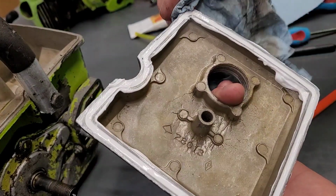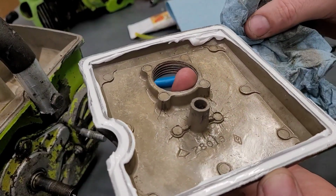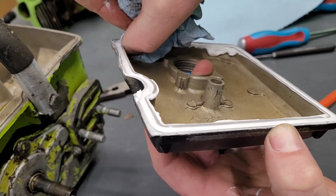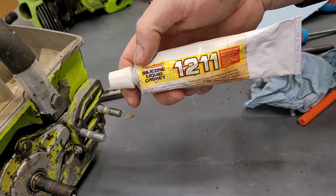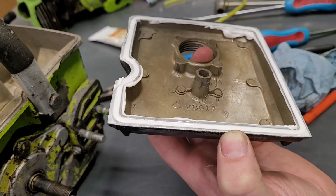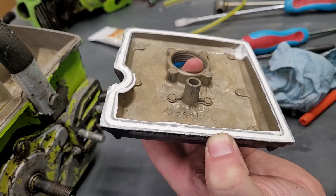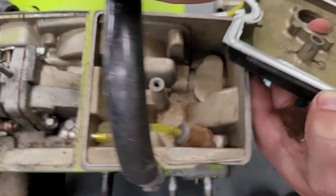And so what I learned to do was just fill up that little channel with whatever RTV mix you use that's fuel and oil resistant. In this case, we have ThreeBond. Let's show you. ThreeBond 1211. It is fuel and oil resistant, so it's going to be just fine and it's not going to leak. And what we have in there, in my opinion, is the very best filter that you can get,